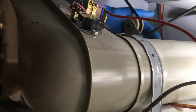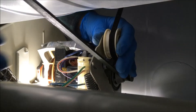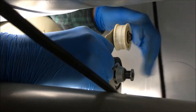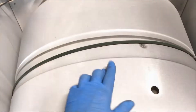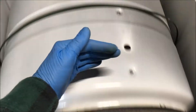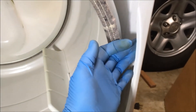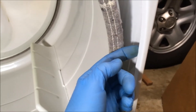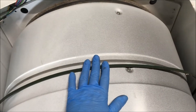I'm reaching my left hand in from the left side of the drum and my right hand in through here. Most people remove the drum by pulling up on the belt — the belt carries the weight of the drum. Here's why I don't like that: there are two indentations on the front of this dryer cabinet that are sharp metal, and when you pull the drum out with the belt, that belt can get caught and cut on that sharp metal. So I wouldn't do it that way.